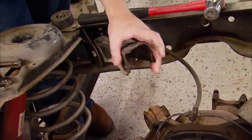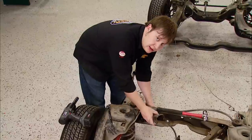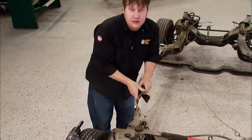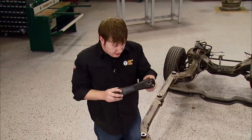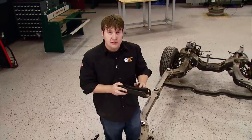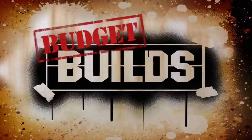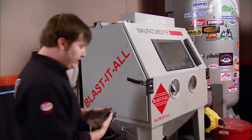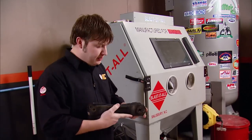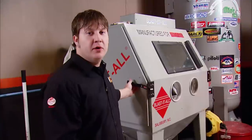They're made out of stamped steel, and GM never felt the need to go in and add a fourth wall in the manufacturing process. Realistically this design is fine for everyday use, but if you're going to do something more aggressive like drag racing or even autocross, there's a low-buck way to keep them from flexing and reduce the risk of breaking something. We've got to prep this thing to do some welding on it, so it's going to take a little trip into the sandblasting cabinet — but a grinder would work too.